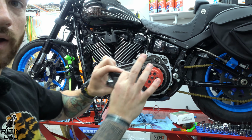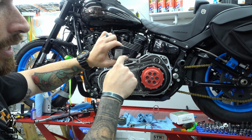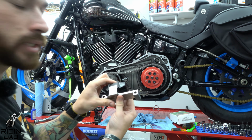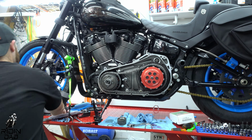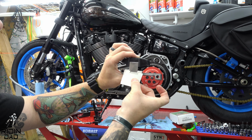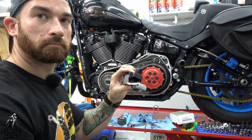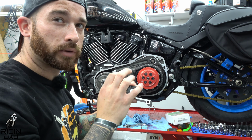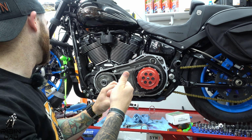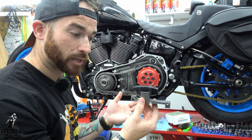You do have to measure it. When you get it on the bike with it installed in the chain, you have to measure the distance between the bottom of this plastic piece and the top of the actual base that it's on. According to Hayden, it has to be about 3/8 inches, no more than 3/8 inches. If it's more than 3/8 inches, you have to use one or both of the included shims. There's 2 different shims. These basically go under there, and that cutout fits right in there, and it sits under the spring and over this plate. I went ahead and pre-measured mine, and I'm all good. Mine measured right around the 3/8, just over. According to Manowar, they recommend setting your spring tension at about a 1/2 inch if you have an actual adjustable one.